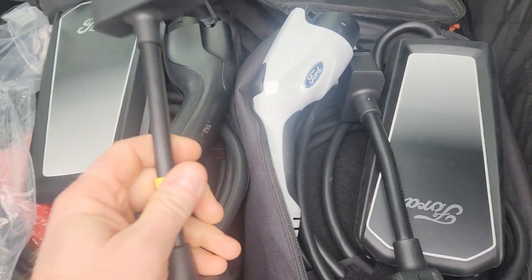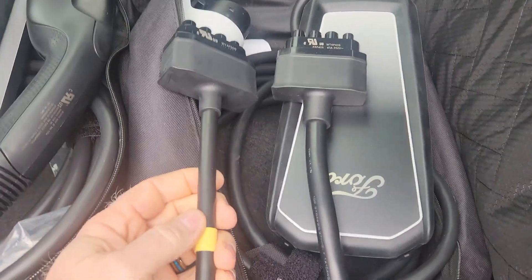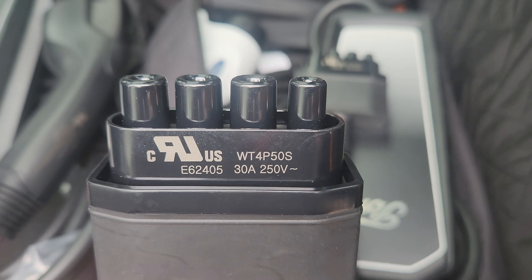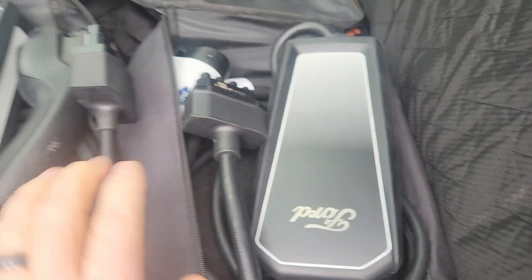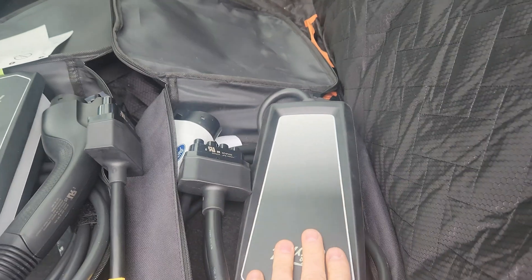The charger on the left is a brand new Ford Lightning charger. It has a smaller wire diameter size and a yellow band around the plug-in voltage adapter, and it's rated at 30 amps. The Mach-E charger on the right has a 40 amp voltage adapter. The Lightning charger has a black handle, while the Mach-E charger has a white handle, and they're both identical except for these adapters.